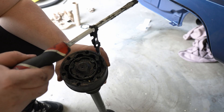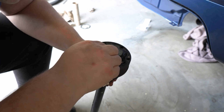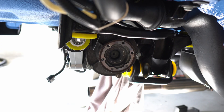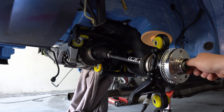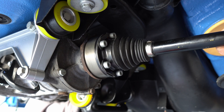Now let's take care of the drive shafts. I was lucky enough to find a used one that looks as good as new, so after installing new seals and cleaning them a little bit they were good to go. I filled up about 70 grams of grease into each of the axles and secured them with the bolts. As the brakes are not installed yet I will tighten them completely at the very end.